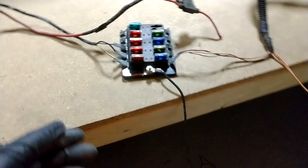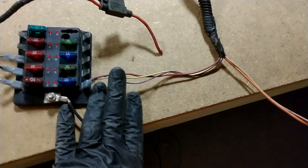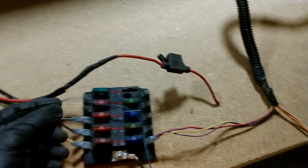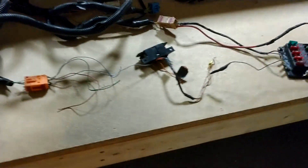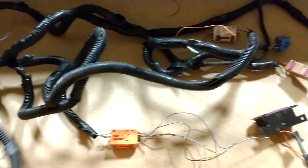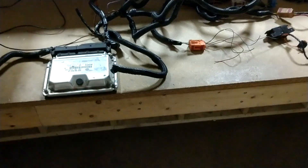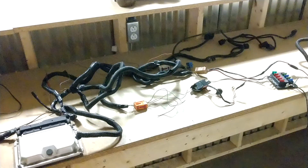That's the basic breakdown. Make sure your grounds are right, delete what you need — or don't, it doesn't matter. Brown plug, three wires. Big connector plug, three wires — that's the main end of the engine harness. OBD2 gets a power wire that goes to the CAN bus. The fuel pedal gets a power wire. After that it's up to your starter to tell the engine it's rotating and the engine will catch on. Hopefully that helps — if you need any more details please comment and I'll get to them as soon as I can.